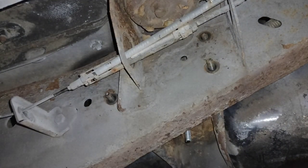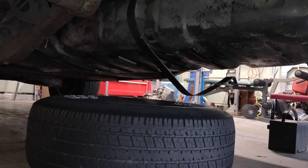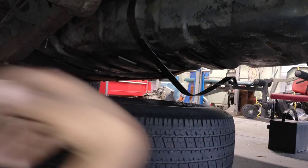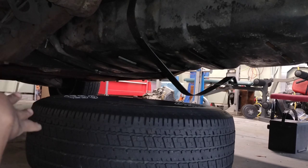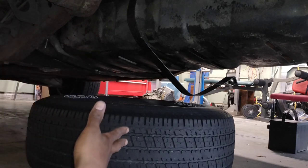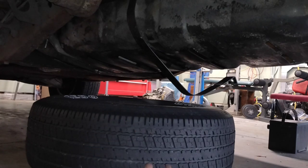Now I'm going to wiggle the tank just enough so that I can disconnect the connections up top. The width of the tire seems to be about the right height such that the fuel tank can sit on it but not put too much tension on the connections up top. So I'm going to push the fuel tank bracket from the front outwards and it should drop onto the tire, giving me just enough clearance to disconnect the lines and the electrical connector.